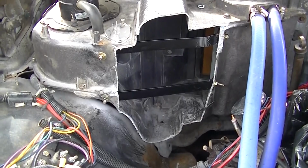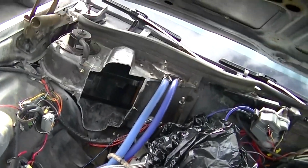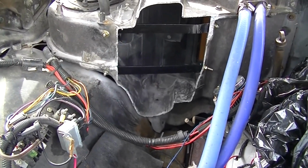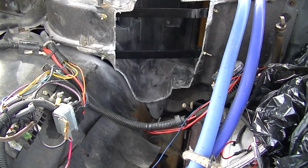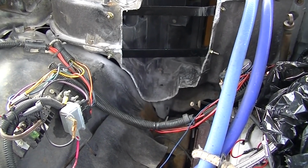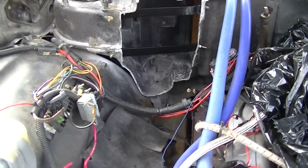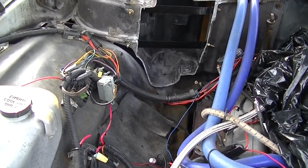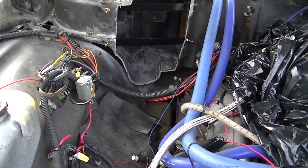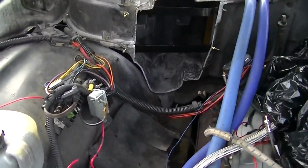And then you also get into the issue of what to use, because a lot of the stuff they sell, you think would work, isn't very strong. Like the RTV, it can be pretty strong, but it's kind of rubbery. So it's not really going to hold the panel too tight, and it may separate just from being blown on over time. And the stuff that's stronger, like that polyurethane stuff they sell that looks like silicone, is supposed to be really strong. Well, if you read up on it, you find out that it has an operating temperature of about 150 to 160 degrees. Above that, the max temperature is like 250, and if you read the documentation, 250 sounds really sketchy. In an engine compartment with hot air and an exhaust manifold, that's sketchy.